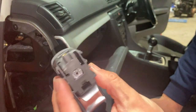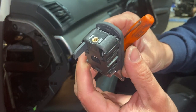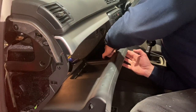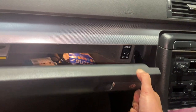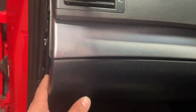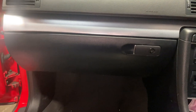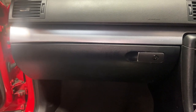The pins just spring out on either side of the barrel - that's just to suit the key. Keep them depressed and pop it into the new one. Sometimes when you're putting it in the tabs just spring out, so you need to locate them as you pop it in and you'll hear it clip home. Once that's back together, simply pop it back in and nip the screw up - only wants a really light nip. All fitted now and we've got the working glove box again. It's not too bad a job. Fairly easy fix and fairly easy access just taking that panel off. The handles are quite dear but that's what you've got to pay. Hope the video helped - thanks for watching!